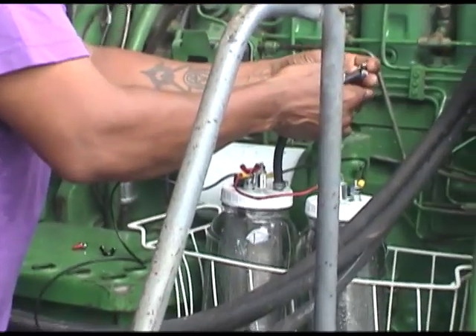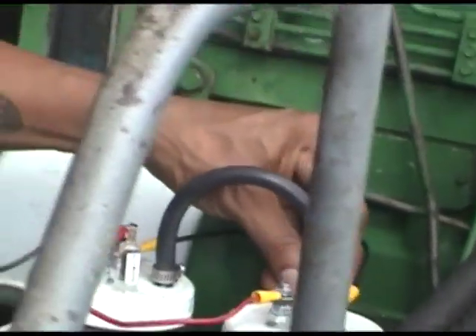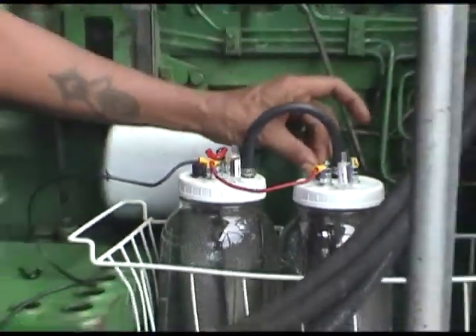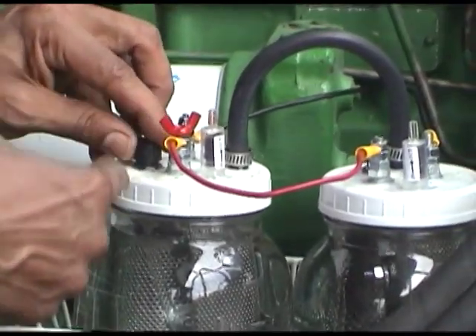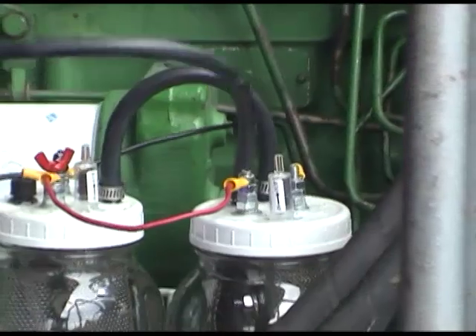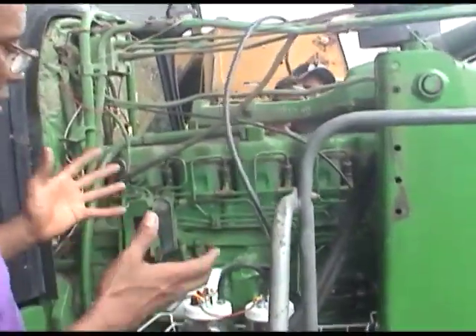We're connecting the vacuum hoses so we can get the hydrogen from one cell to another. These clamps are very important — the most important thing is you can have no air leaks. Air leaks will basically ruin your results. That's why you see all this shiny stuff — it's called Goop. I use Goop to seal the ports, the check valve, and this is the regulator that regulates the vacuum pressure. Air goes in, pulls through here, produces hydrogen, and the hydrogen goes in here. Then another hose runs right into the airline and the hydrogen goes into the engine using this. Wire tie it down, make it secure and out of the way of any moving parts. Everything must be as airtight as possible so we get all that hydrogen going right into the engine.